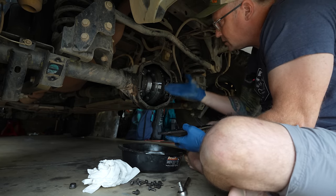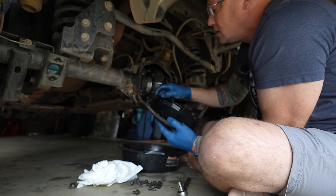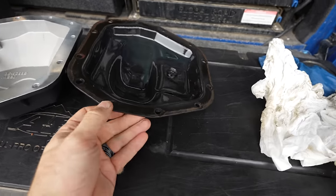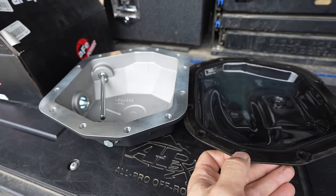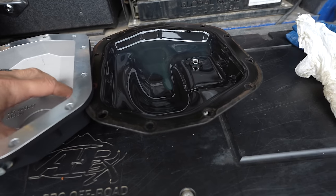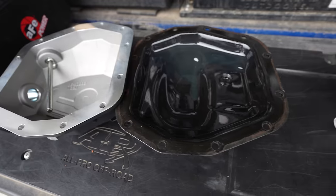There — the brand new gears. You are going to reuse the factory seal here. I love that these now come with gasket seals and you don't have to deal with RTV anymore — that is fantastic. Comparing these side by side, you can see just how much deeper the AFE diff cover is compared to the factory and how much extra space there is for more fluid. This dimples in here — there's very much a deep reservoir there. Quite a bit different in design and how much fluid they can hold.